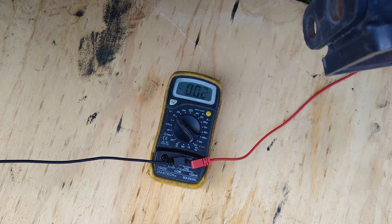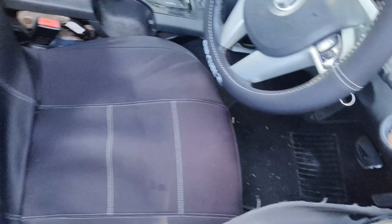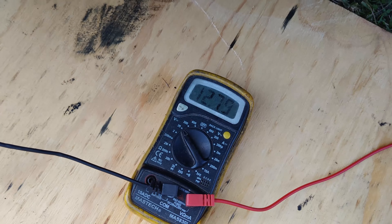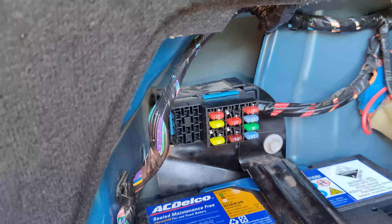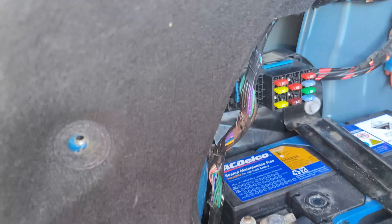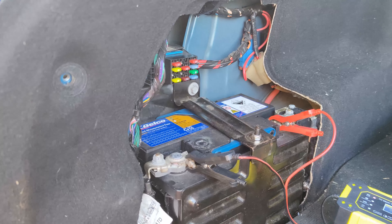I'm going to come down underneath now where there used to be a connection and see if, when I twist those wires, is there anything joined together or what's going on. I'll see if there's any power on any of these, because there should be with the light on — one of these should have power. Right now there's no power, but I'll go turn the parkers on. I've found out which wire it is — now you can see there's power on that. Since there's live there, I'm going to see if there's a wire going from there to that plug as well. I've checked the fuses and they're all okay. I've also got the car on charge because I've got the lights constantly on and don't want a flat battery. So now I'm going to run a wire from one side to the other, just as a test to start with, and then probably make it permanent that way.